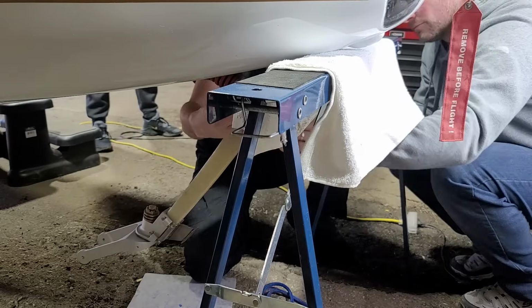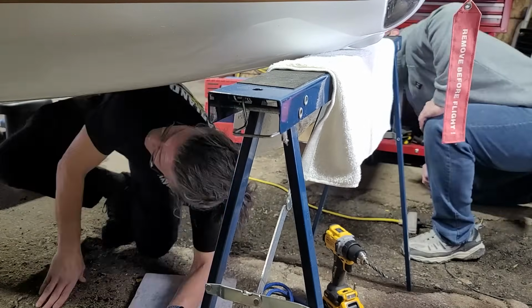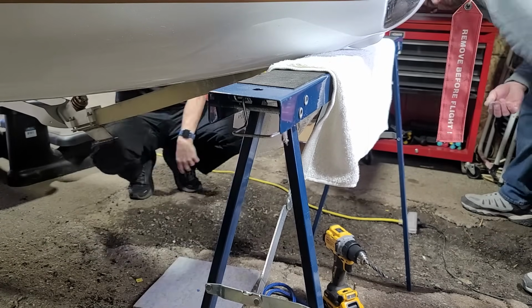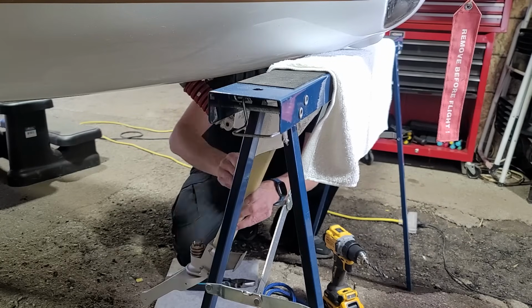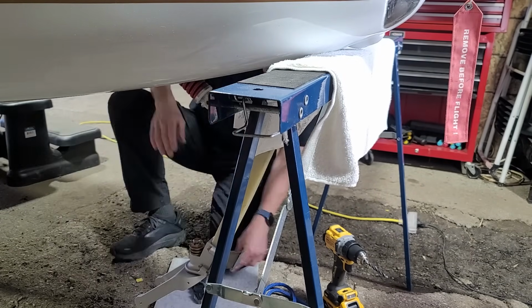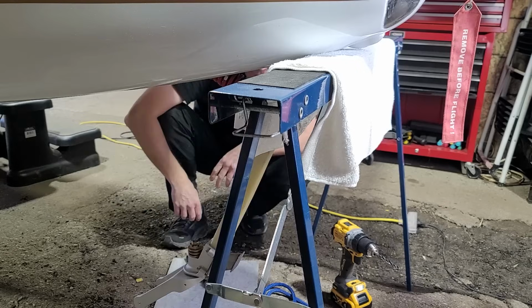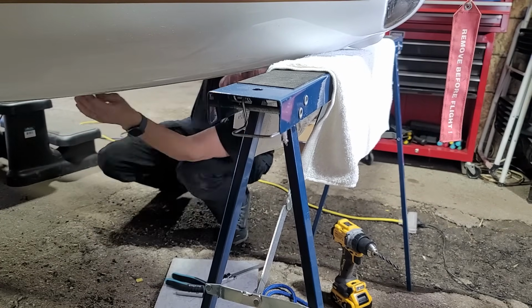So now I've got the gear installed, and it definitely fits with the actuator properly. You can see I got it retracting. I did need to change the up limit switch position because the strut's slightly larger than the old one, but it definitely worked. You can see I disconnected it. I'm going to reconnect it after I've adjusted the switch, and it definitely retracts properly and extends properly.